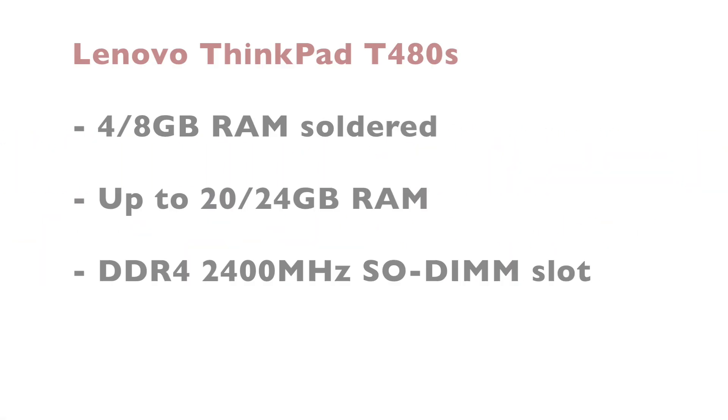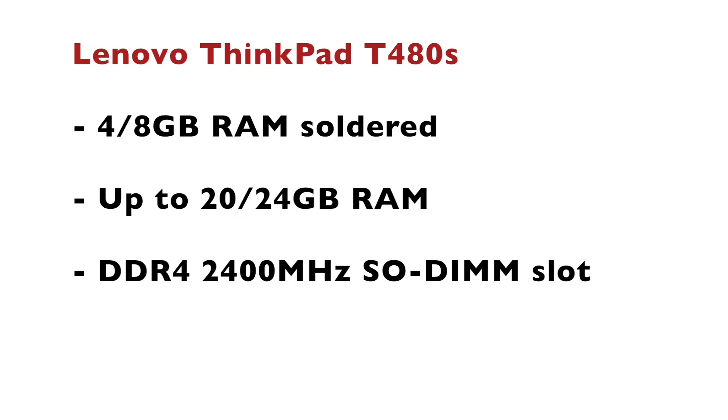At the end of the video let's summarize: I've showed you how to upgrade the RAM on a Lenovo ThinkPad T480S. This model comes with either 4 or 8GB of RAM soldered to the system board and supports up to 20 or 24GB of RAM. The RAM type is DDR4 that works at 2400MHz, and there is a SODIMM slot which allows you to perform the upgrade. The quick memory test in Lenovo diagnostics passed, and as a Linux user running Ubuntu 24.04 — the latest stable release — the RAM was also detected through the Ubuntu graphical interface as 16GB. Everything is fine and my old ThinkPad T480S is ready for new challenges.